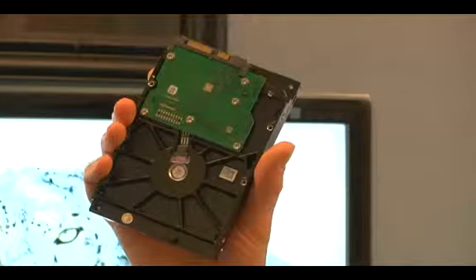If you're using an older style PC with IDE drives, then you'll need to configure your hard drive as a master or a slave. You'll need to check the jumper settings and make sure that when you put the drive in, your computer and your BIOS can recognize that drive.